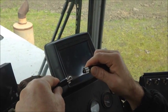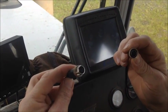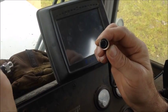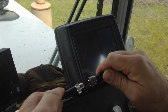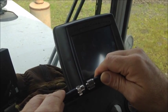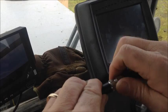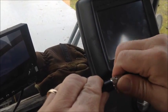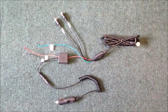As you're installing the electrical portion, this is probably the most critical part of installing the camera system. You've got an eight-pin connector coming off the monitor going to your harness. It's very important that those two arrows are lined up directly. Please don't force those together — if you do and the pins get bent, it will cause the camera system not to work.